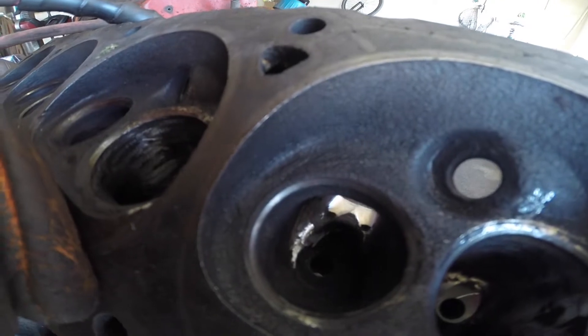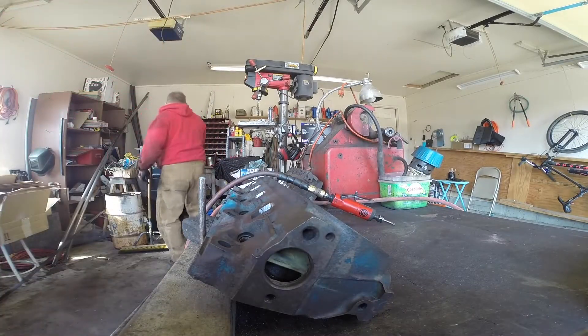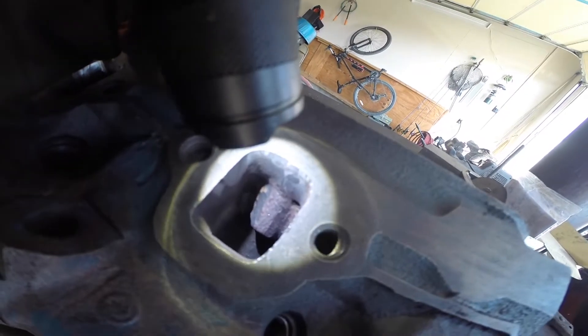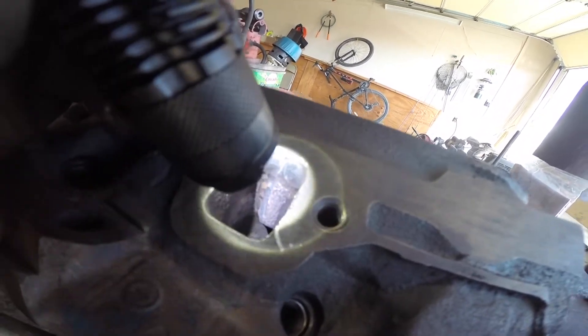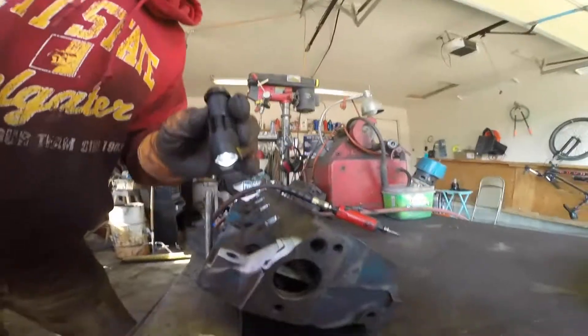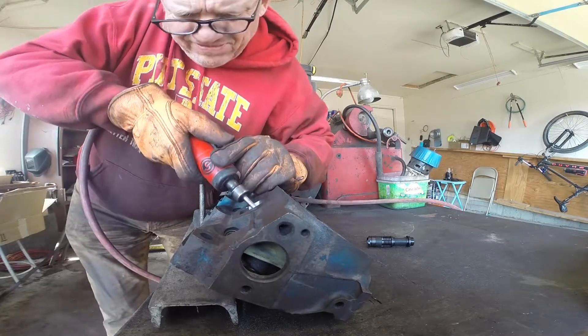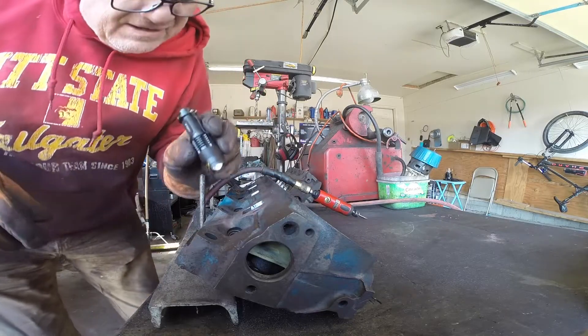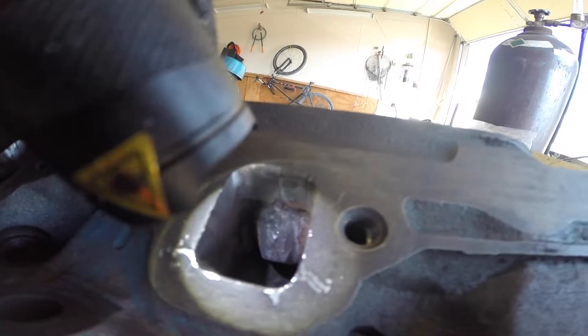You can see how we're getting it shaped up there. We'll try going through the port from the other side as well. You can see I'm getting that roughed into the shape, and I'm going to bring it in on the other side. It's lower speed on this side so I want to be careful not to mess things up, but I'm going to shape that into the fin on the back part of the wing and round it into the base of that port. We're going to round it and smooth it a little bit more to get that fin work there and then call it good.